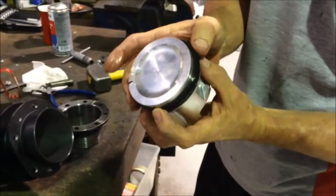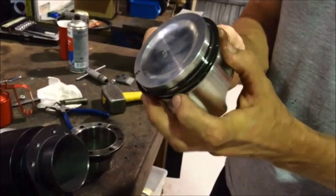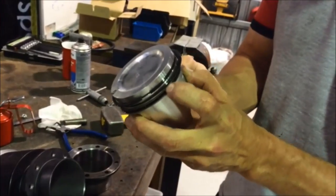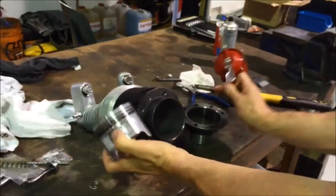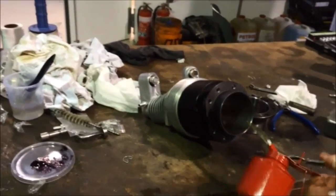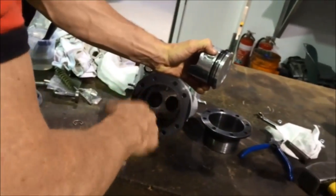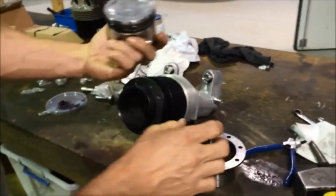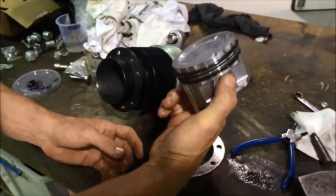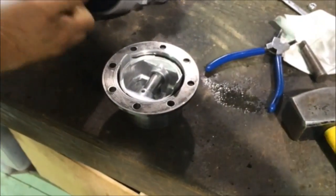Separate these gaps at 180, and the oil scraper — set that gap at 180 as well. There are two scraper rings there — one gap, and there's the other gap. Put a couple of squirts of oil on the cylinder and swish it in a bit. This is one of the best tools we've ever made at Rotec — it's a ring compressor. Just slide it in, notch to the bottom, slide it in, barrel up.